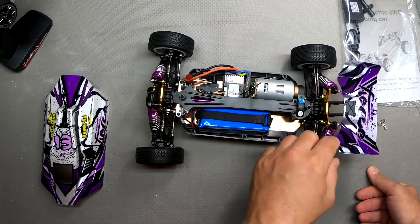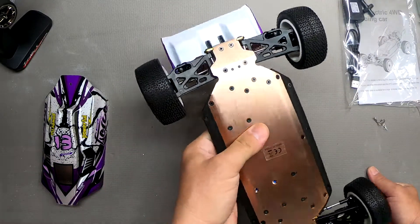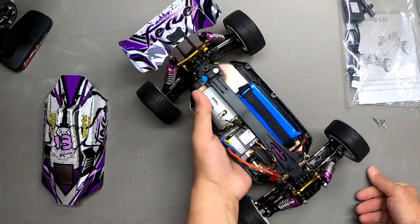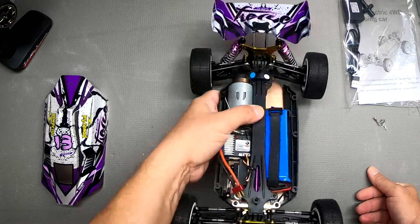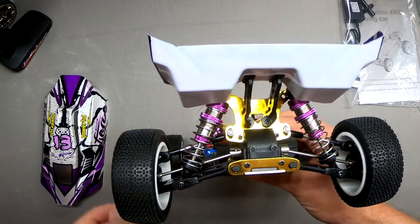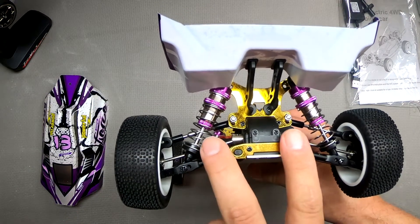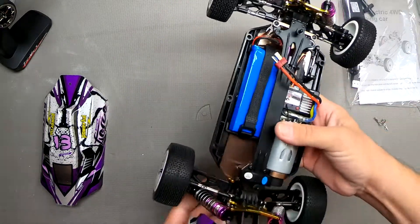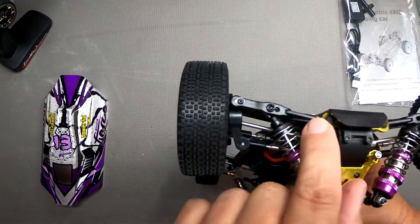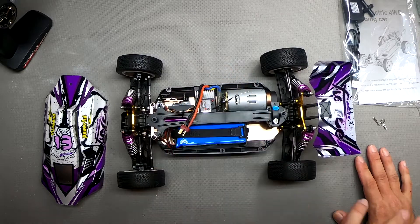It's got a pretty big motor — I think it's a 550 size. There's a nice wing with a bracket that holds it in position. It looks a lot like any high-end RC car. We've got a couple of suspension pills in the rear that are elliptical left to right, so we may be able to flip them to adjust toe. The front ones may move up and down to adjust anti-squat. It looks like there's some front adjustability there too, so I want to take this apart and really go through it.